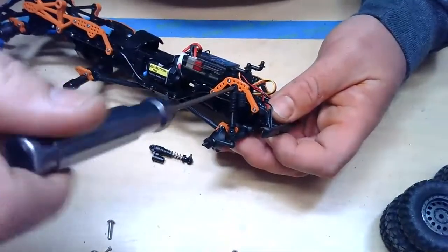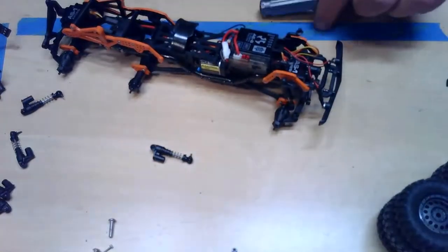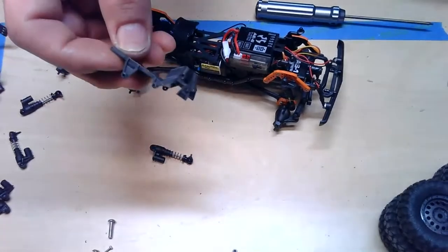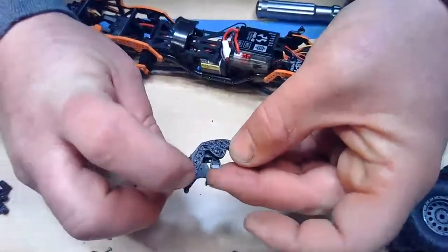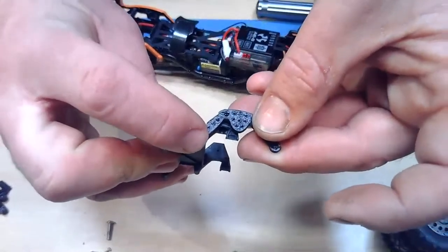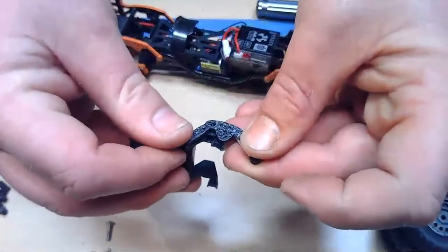Before you put these screws in, check for clearance behind them. Some of these holes, let me grab something to show you a little picture here. You've got your ESC tray with your shock mount and your body post mount. And then you've got something like this that's going to screw onto it, at that battery mount point, and here. You see how some of these holes have shock tower behind them, a bunch of crap in the way. On the back side, you've got plenty of clearance there. But on the front side, you might run into these shock towers with the screw if you're trying to find a particular hole you want.